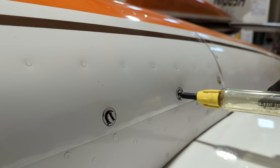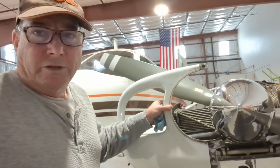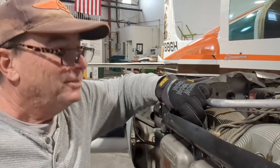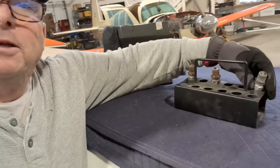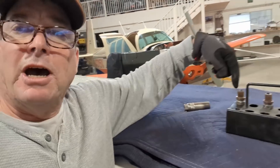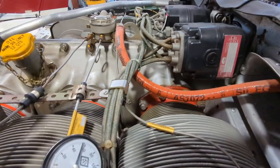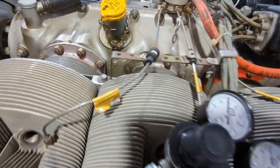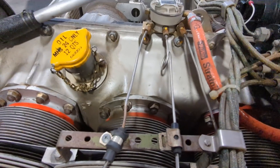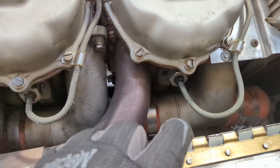These cowlings just pop off with these Dzus fasteners. The nose bowls come off in two halves. How many is that? Three, six, twelve — only 24 more to go. You can take a quick reading on these spark plugs just by taking a good look at them, and you want to keep track of them in this tray — one, three, and five, top and bottom — as each cylinder has two sets of spark plugs, times two engines. The cylinders on the O-470 are numbered two, four, six and then one, three, and five. The red band indicates a chromed cylinder — all of these are chromed. We'll pull the top plugs for now, leave the bottom plugs in for the compression test, and pull those out later to clean them after the compression test.